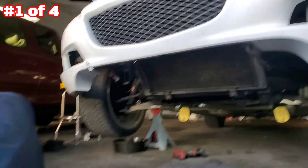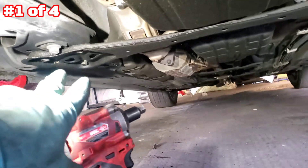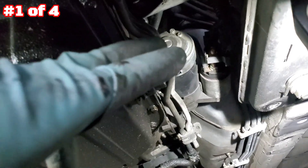Quick video on how to remove the starter on an automatic transmission. First, lift the car onto jack stands. You're gonna go under — you'll need an impact or ratchet, a 19 millimeter socket, 17 millimeter, 12 millimeter, 13 millimeter, and 10 millimeter. First, remove this bracket — the center support under here. One bolt is 19 millimeter and the other two are 17s. Remove that one first. The reason I'm removing this is because the engine is coming down, but I'm also just showing you how to remove the starter.